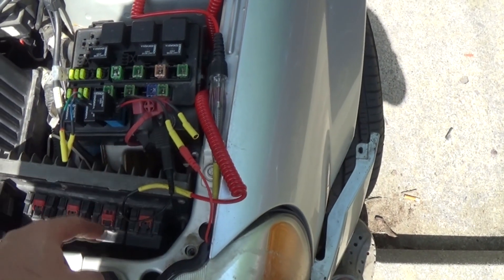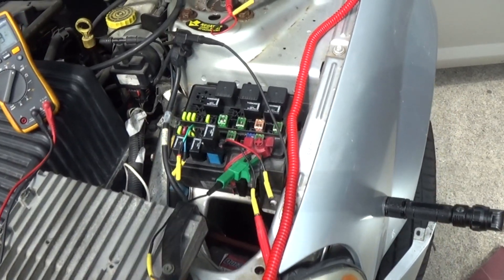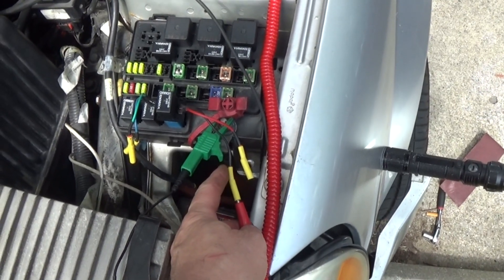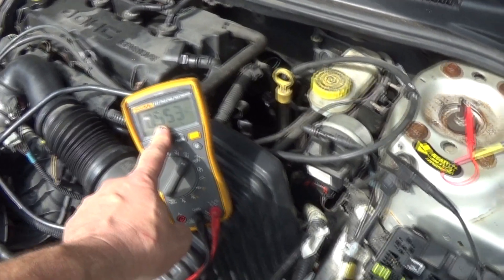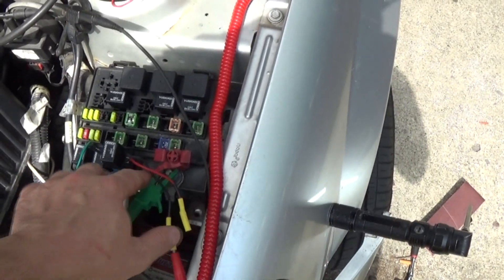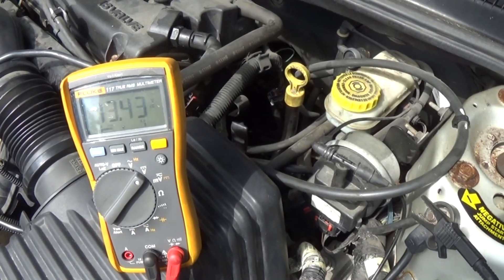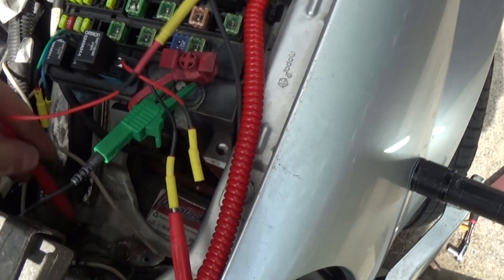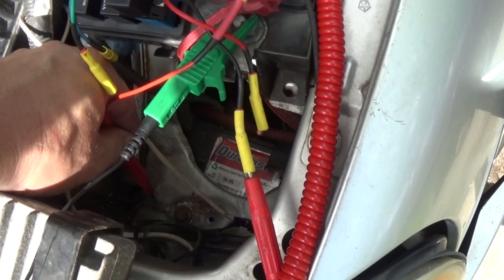I'm going to have to remove the headlight to find that ground. On the ground side of the control side of the relay, with the circuit open I'm seeing half a volt, which is a bit too much. Test light connected to battery positive to load the circuit — the test light is not lighting up and I'm reading 13.5 volts, which means a direct open circuit. There's an open somewhere between this point and the fuse box.